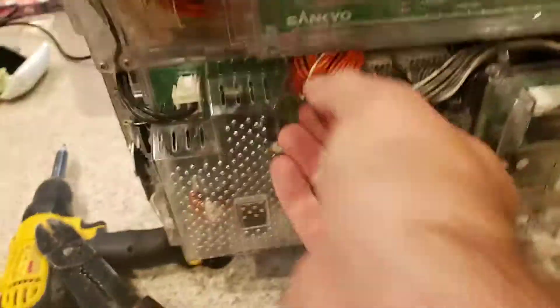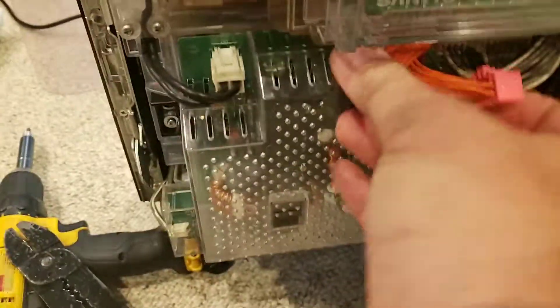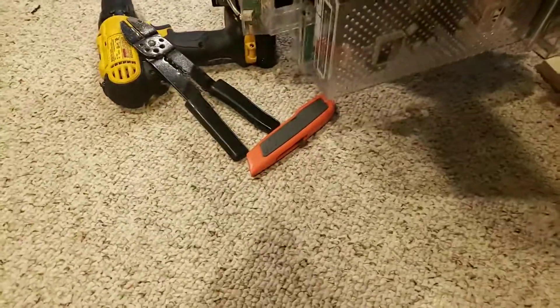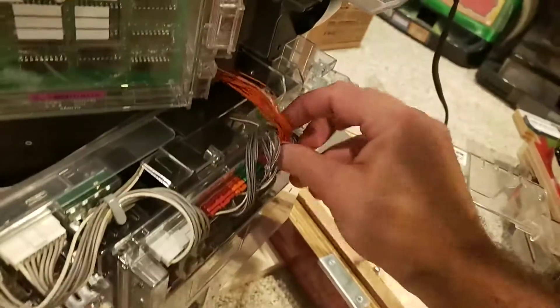Then, because you'll see it won't open, you have to open up the lower panel here. Anything that is pink is disconnected — so there's these two. As you open it, you'll see this one. Those guys are all disconnected, and this door should, with a little wiggle wiggle, open up. Your wires will get caught on stuff, so just bear with me.